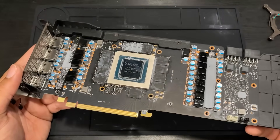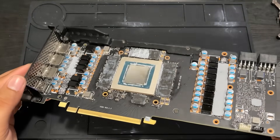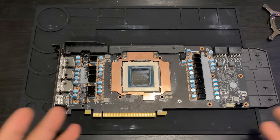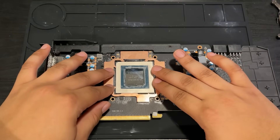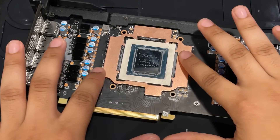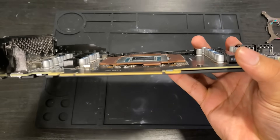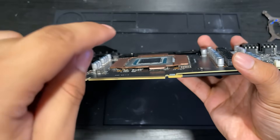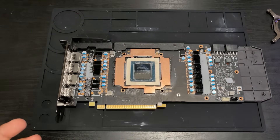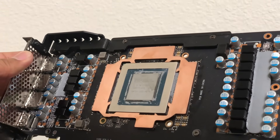I've gotten the PCB pretty much cleared off. There is a bit of residue from the thermal pads that were previously on here, but that's completely fine. Now's a good time to test fit the copper shim — and it literally just goes right on. It's securely held in place by the corners, which is really cool. The plate does appear to be a little bent, probably during shipping, but since copper is soft we can either bend it back ourselves or just wait for the heatsink to press it straight into place. If you get one and the plate is significantly bent, definitely take time to bend it back to make adequate contact with the GPU memory chips.